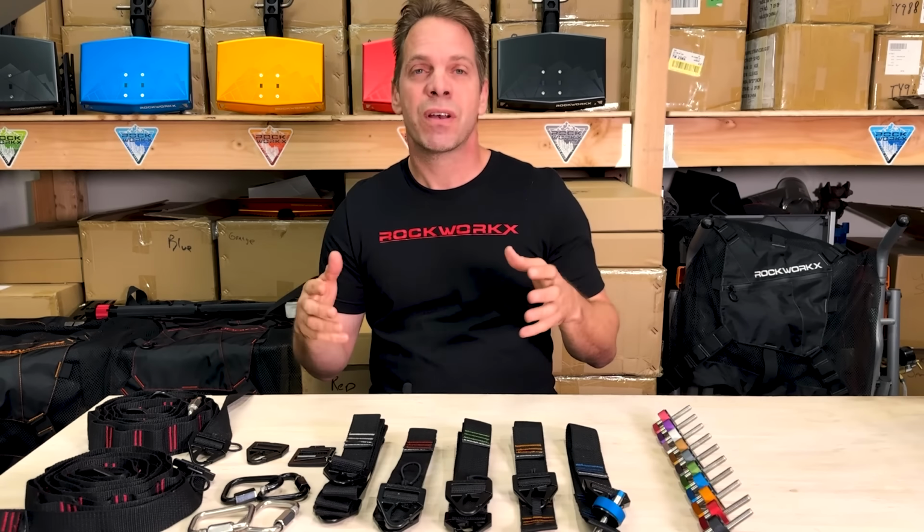So firstly, I wanted to show you the custom buckles that we have. These are designed and tested in-house. They are cast steel, so they are really strong. The design on these, what we have is, firstly, these lock directly to the thumb screws that are on the rear portion of your hardtop, with a locking gate. That locking gate stops them from jumping off, and that also adds additional strength.